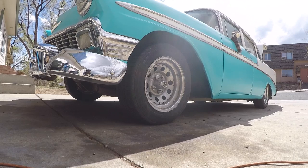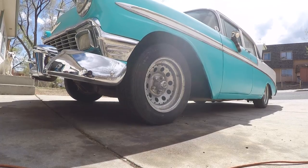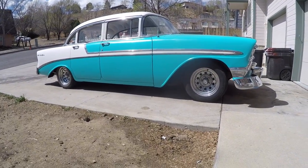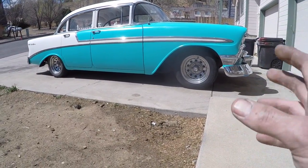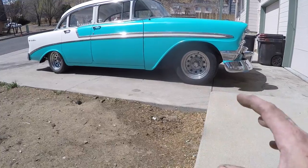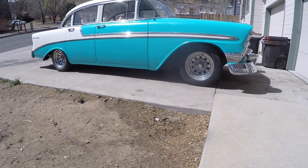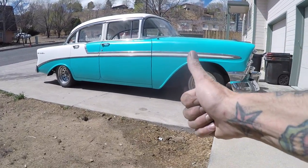There we go — it's definitely lower. I'd probably want it a little bit lower in the front, so I may have to pull everything and do a link off the top. Should be a little easier now that everything's loose. It's significantly lower, it's pretty level — may be a little high in the front. I'm going to give it a few days to settle and see how I like it. I may still go a little lower in the rear and in the front, but I want to get the rims and tires first before I do any more lowering, so I know I don't have any tucking or rubbing issues. Like if you like the video, subscribe if you want to see more, and as always guys — keep on modding.